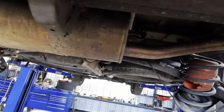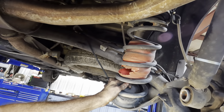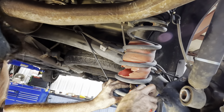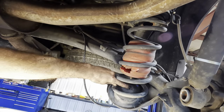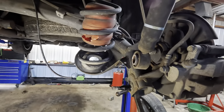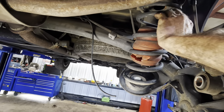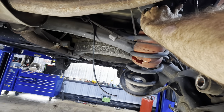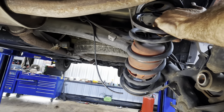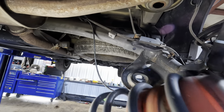Now that I think I've got the procedure down pat, let's go over to the other side and do the exact same thing. Get that line out of there and cut it. Get the puck out. Pry bar going into the hole in the axle, and I'm going to give this a shove downward just like the driver's side. Shove the axle down. Spring's coming out — oh yeah, this is easier than I thought it was going to be.